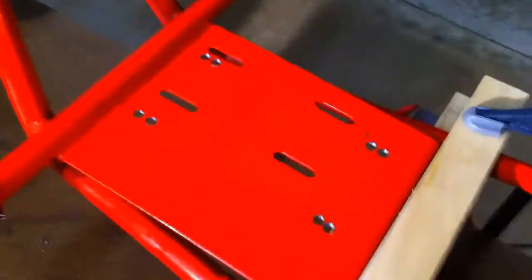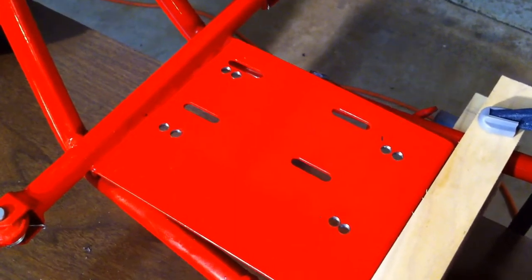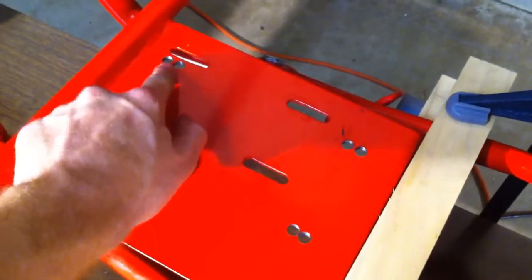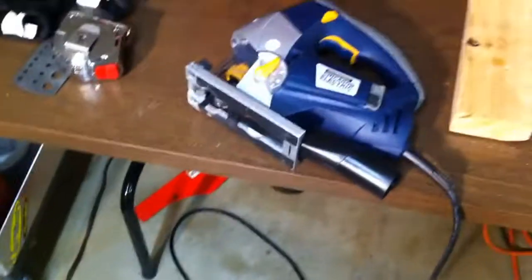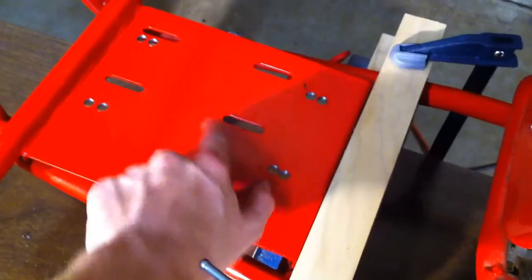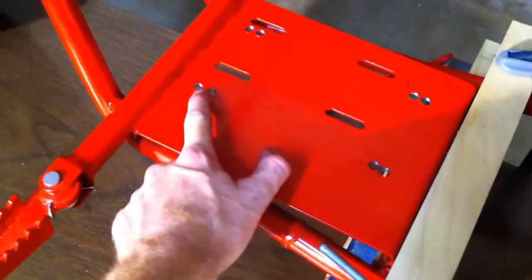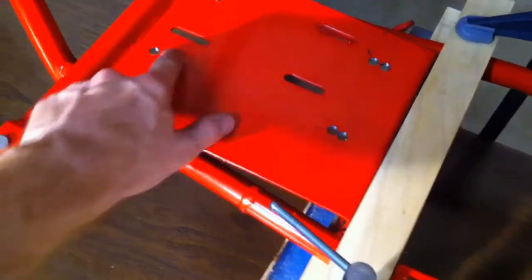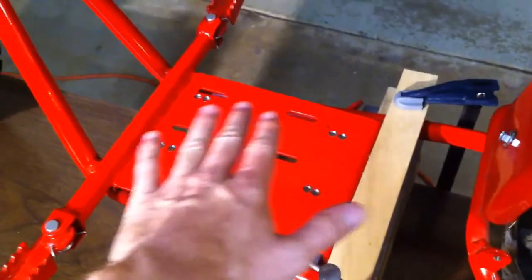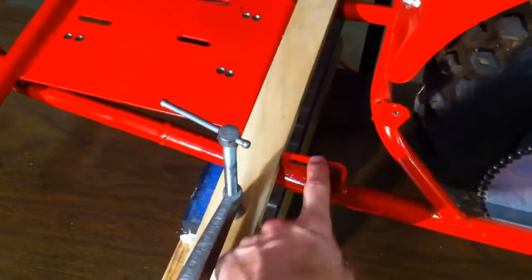Onto the actual holes. I've drilled my four holes as Pasty Boy suggests, except instead of turning the drill bit sideways at an angle to cut through the small bits left over, I'm going to try and use my fine blade jigsaw to cut those out. If not, I'll use a cutting disc to get a nice clean slotted shape — drawing a line from the tip of one circle to the tip of the other, center to center, and cutting right across so it becomes a slotted shape. This allows the engine to move back and forth slightly so you can adjust for chain slack.